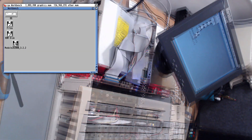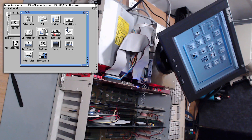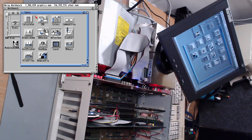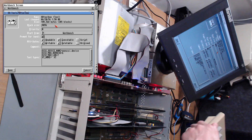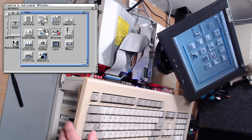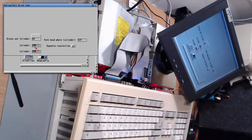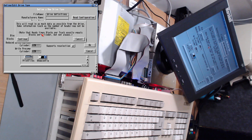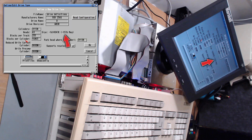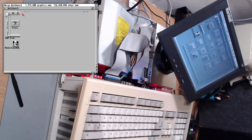So I want to install OS 3.2 on the new card, but before that I need to prepare the M.2 drive and create a partition on it. To use HDToolbox, we need to reconfigure it to use the LIDE.device instead of the GVP SCSI.device. When we run it, it sees the new device. However, there's a reason we don't want to use the Workbench 3.1 version of HDToolbox — it just can't handle drives that big. It's a 250GB drive, which is kind of ridiculous for the Amiga, but that was genuinely the smallest one I could find. So we'll need to use the Workbench 3.2 version.